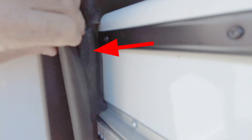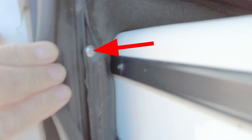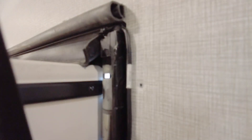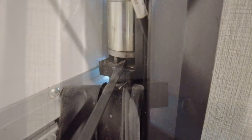Next, go outside and pull back the bulb seal right over the rail. You'll see the square-headed screw that secures the motor — pull that screw out. Back inside, carefully remove and then disconnect the wiring harness. You'll now be able to pull the motor out.